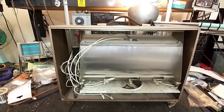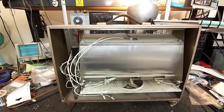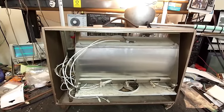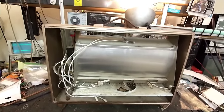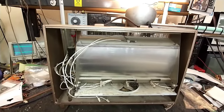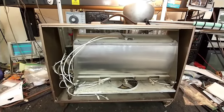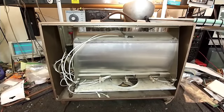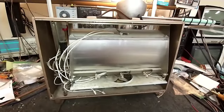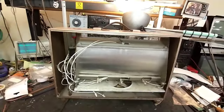So it's a good idea to update these with a three-wire cord. We're going to use an appliance cord rated for about 20 amps, and we're going to ground the case so that the machine is earth-grounded when used, assuming your house wiring is okay. We're just trying to make this so that it's safe to use.